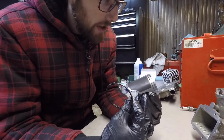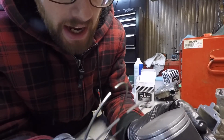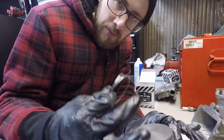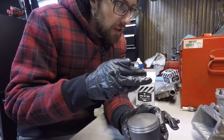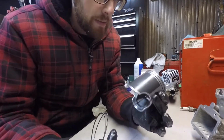I got my piston here. You can see there's a couple little pins in the grooves, so obviously the gap has got to end on that little pin. It's like that in two-stroke motors and probably some other motors also. There's pins because if these rings spin and get into the wrong place, it'll catch one of those ports. You can see there's probably 10 ports in the engine. The ring will snag on that if it doesn't stay in the exact spot.